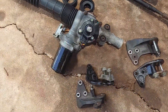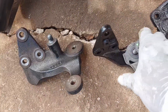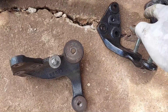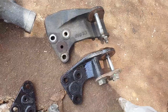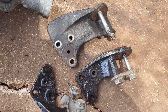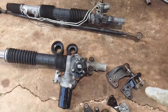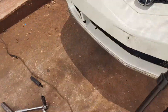All right, side-by-side comparison with the brackets. This is the original DC5 hydraulic bracket. This is the electric bracket. The only difference so far is this one is slightly bigger — not really bigger, it just carries this little extra part right here. This is what made the difference. Now I'm going to put back the electric bracket in the DC5 so it can accommodate the electric power steering.